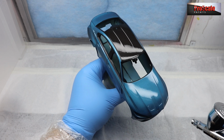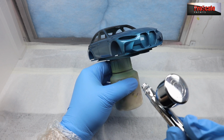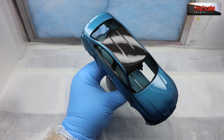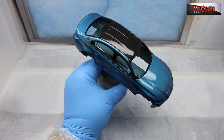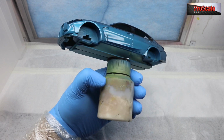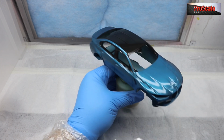but it does work out faster, quicker, and easier because we don't have to remix a second batch of clear coat like I've been doing lately with other 2Ks. It's only a 5-minute flash off time, so it's a lot faster. And I'm finding this 2K is laying down absolutely beautiful and not looking overly thick either. Make sure you're getting your wheel arches as well.